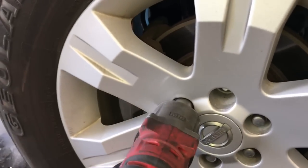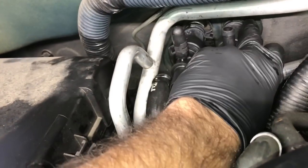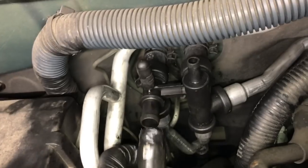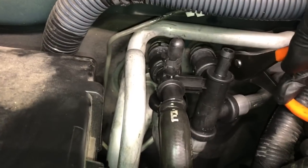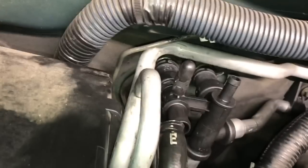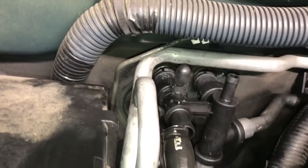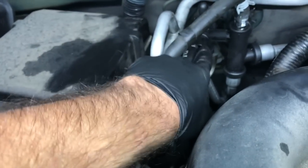Go ahead and reinstall the wheel and bolt it up. Back at top, make sure the hose clamps at the very back towards the firewall connecting the heater core pipes are secure — squeeze and quickly release them to pop them free. Hook the hoses up and make sure all hose brackets are connected. Slide each hose on and put the clamp on — just squeeze these clamps and rapidly release them to pop them free. Make sure the ones furthest in the back are secure, then install the other two hoses and re-secure the clamps on those as well.